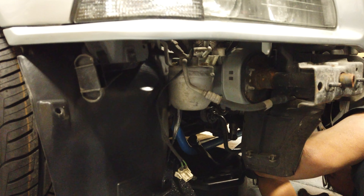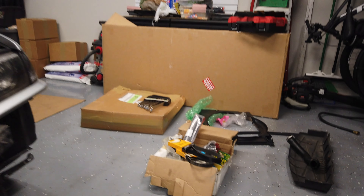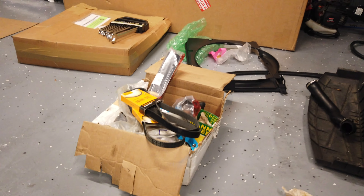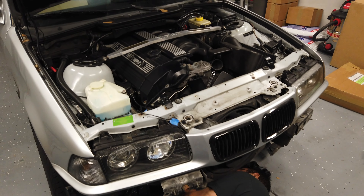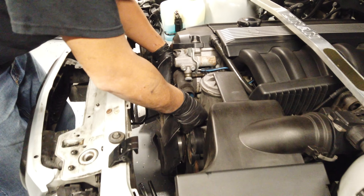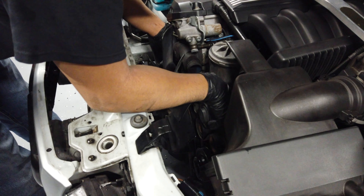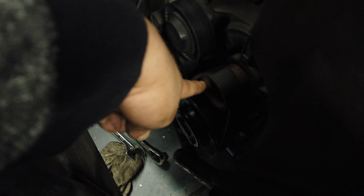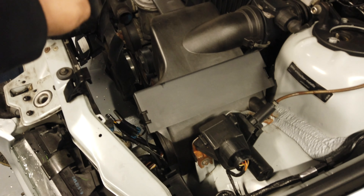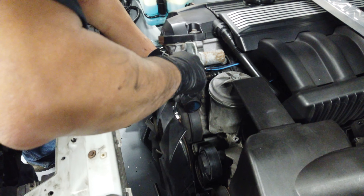Now we're loosening the idler pulley so we can take off all the belts on the car — I bought brand new ones to replace them and get the car running as fresh as possible. That will also give us the space we need to work on the top. I bought a 32mm wrench but it was too thick, so we found a trick online: you take the serpentine belt, wrap it around that pulley, wrap it on itself, and attach the end here. It applies enough tension so you can loosen the top of the fan blade — it's only about 30 foot-pounds, so it's a quick trick if you don't have all the tools.